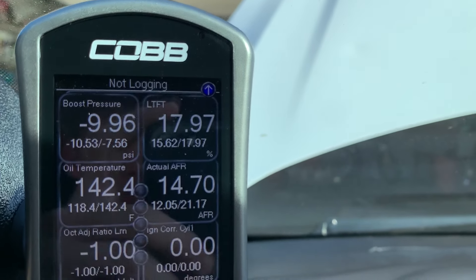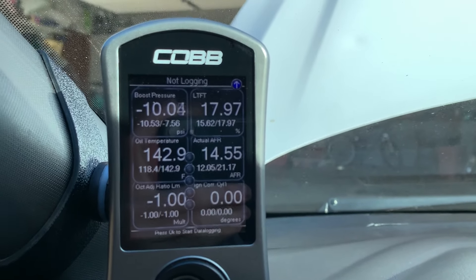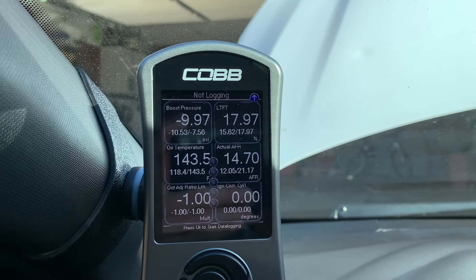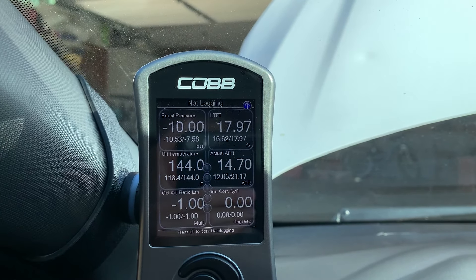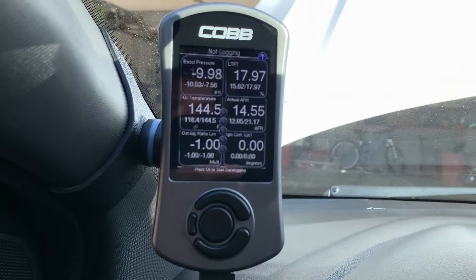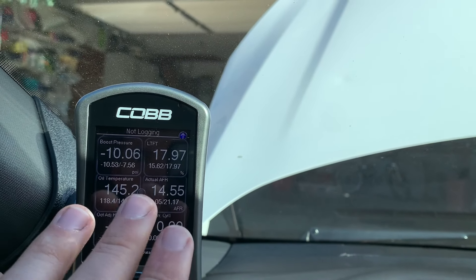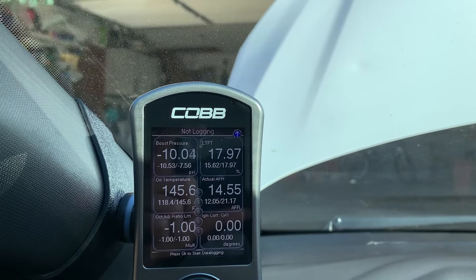Here I have long-term fuel trims. This is mainly for my car — some people might want to monitor charge air temp or intake air temp instead, because it's interesting to look at. You can also look at battery voltage on this; the Focus ST doesn't have a gauge for that, so I monitored it when I was having battery issues. I have the long-term fuel trim on mine because my O2 sensor is bad and I also have an issue with my wiring harness, which means this number is not accurate for me right now.